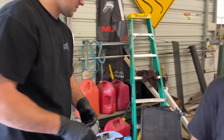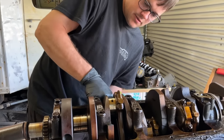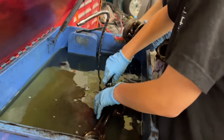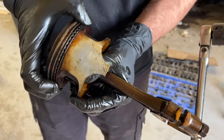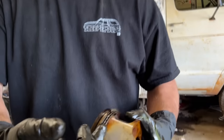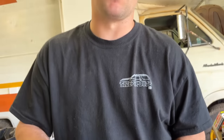She's dirty. This thing doesn't have a ridge at the top of the cylinder really, so these pistons are really easy to get out compared to like an old carburetor engine. That oil ring there is completely stuck — it won't spin at all. What symptoms would the car have with that? It would smoke, especially under hard acceleration. You need that ring to float and push out against the sides to keep oil from getting past and up into the combustion chamber. If any oil gets past there, it smokes blue. But just because she smokes doesn't mean she's broke.